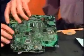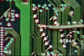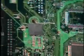Well, you think those are small. There's one on the back. Let me show you the one on the back. If you take a look here, this little solder point, that is the tiny one. That's called the D0 solder point. If I accidentally get solder on any of those other dots or on the lines there, what happens? Yeah, you're going to break your Xbox pretty much. That's what happens. You have to know what you're doing.